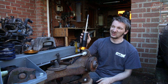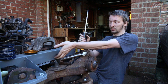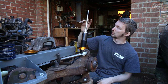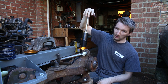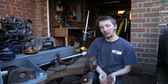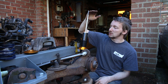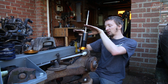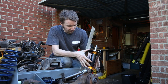There was originally a bump stop inside the coilover which ate another inch and a half of travel. Since we've got a bump stop on what was our coil spring mount, and we're going to put a little plate on the bottom of the chassis, we can lose the bump stop in the coilover and use the external one — getting all five and a half inches of travel. To set the top mount position, we fully compress the strut; the hub is sitting at full compression, as high as it's ever going to come, with a little tolerance.